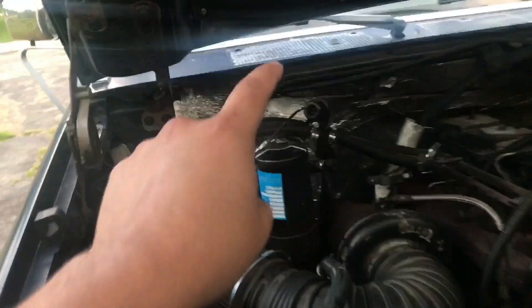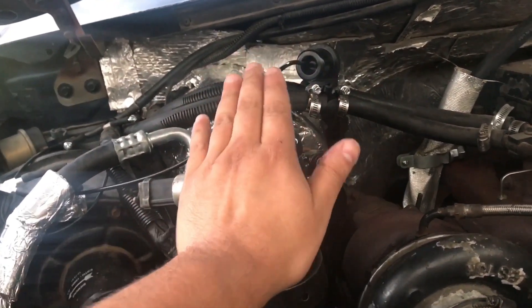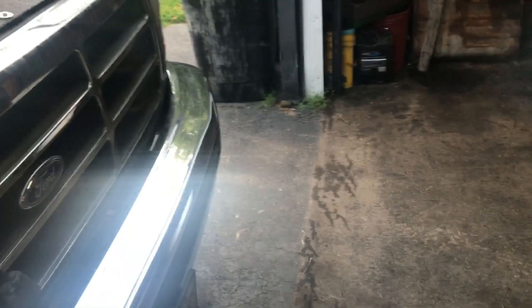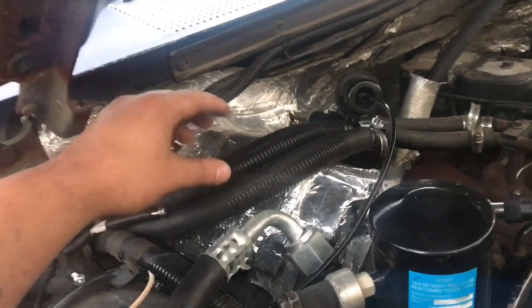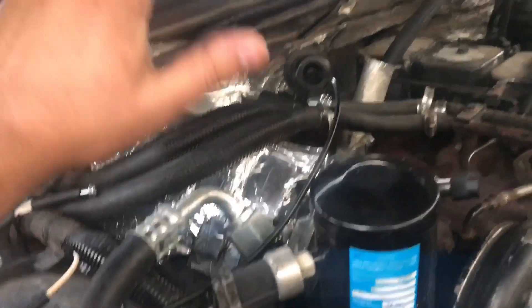This is my test setup. I'm going to let everything idle for 15 minutes — first with the mod connected, then with it disconnected. With the vacuum line plugged off and not connected, it'll simulate the before-mod condition. To avoid throwing off results, I'm running the mod-installed test first so there will be no coolant going into the heater core at all during that run.